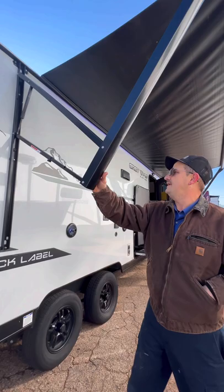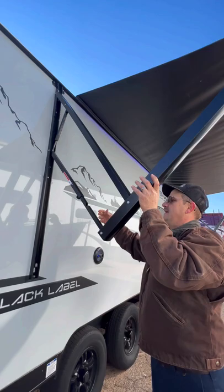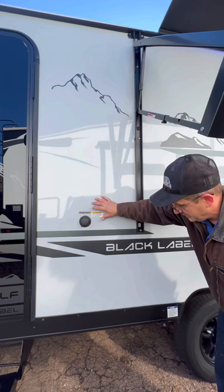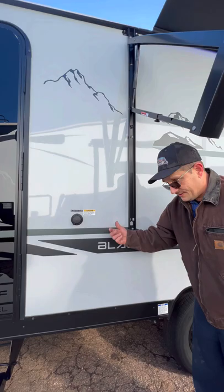Here's going to be your awning arms. If you've got it out and it's raining or high winds, you might want to roll it in to keep from damaging your awning. If you pull this down here, shut that tension screw, then all your water will drain off of this end. You'll loosen that up for storage and let it pop back open. Once you have dumped your black tank — this is on the opposite side of your camper — you can hook your water hose up here to help flush everything out. Just rinse for probably a minute, minute and a half, pull your black handle on the other side, repeat that, and you see nothing but clear coming out.